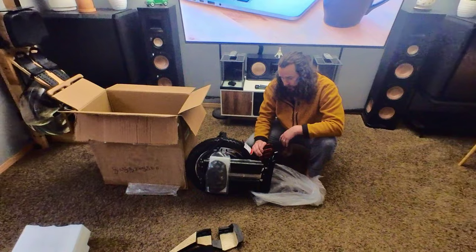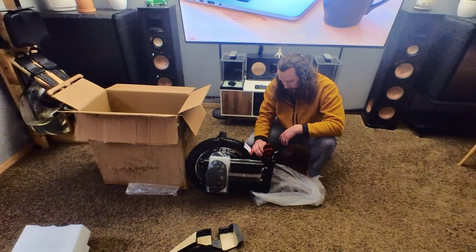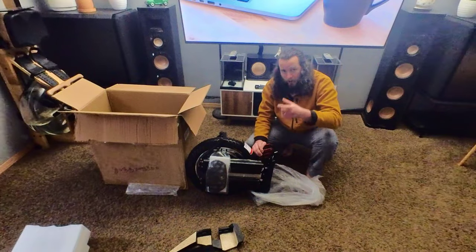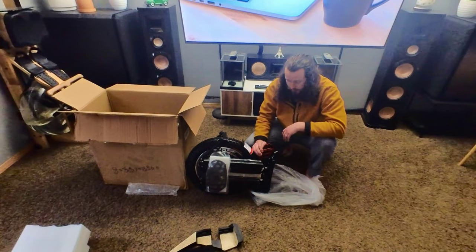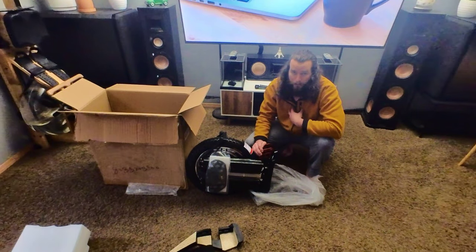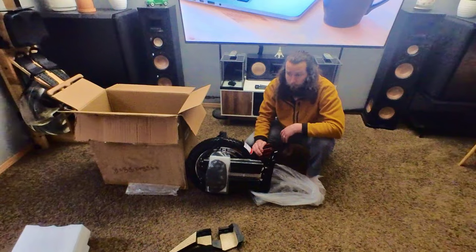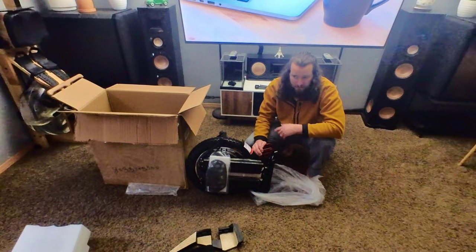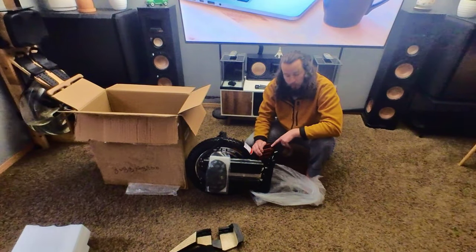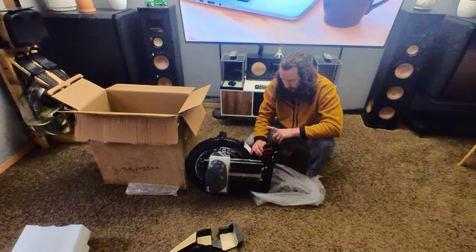On the coil — which I'll be switching over to — it's a matter of how much preload you put on the coil. I'm using a 650-pound spring on the Hero for my weight of 225. I had to go about halfway up the threads to feel like I'm not bottoming out the shock. For an average rider my weight, you'd want a 750. For anybody 180 pounds and less, 650 is fine. The 650 is standard for a 190-millimeter shock, which comes with this wheel, the EX20S, and the Hero.